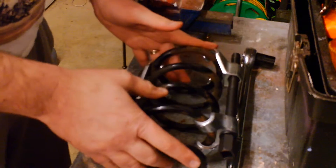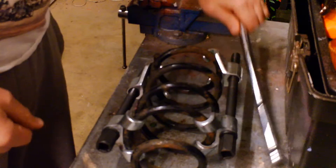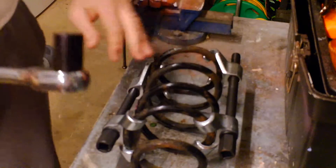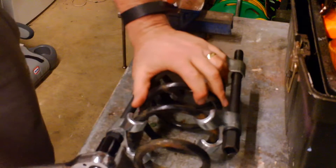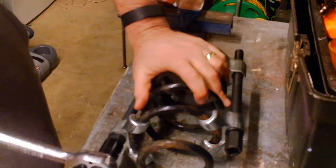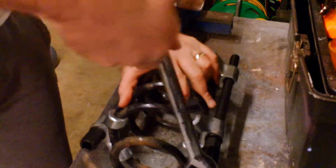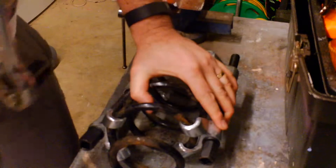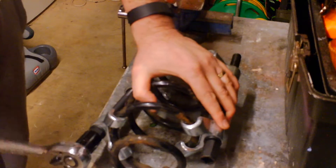When I'm compressing it, there's two ways of doing it. One is with a ratchet — obviously you've got to get the right size socket — and just do it slowly. Take your time, there's no rush. Just do so many clicks out on each side. Make sure it compresses evenly. Perhaps count up in tens how many times you wind it on each side to keep it balanced.